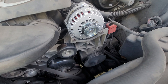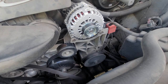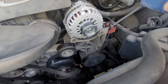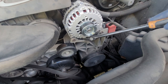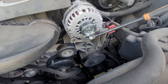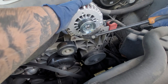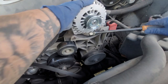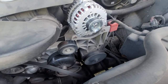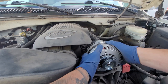Now you're going to need a pry bar. Get something wedged in there, and from the back of the casing just tap it with the pry bar, then go from the other side as well and tap that side too. Let the alternator wobble out — the cover might be in the way; if so, let it wobble and walk it toward you. If you need to take the cover off, there's an 8 millimeter bolt right there. And now we have it off.